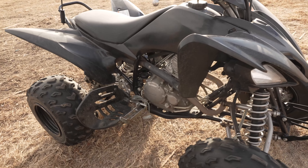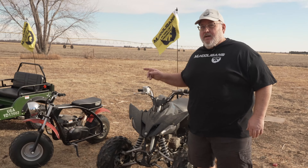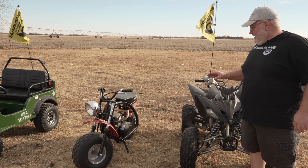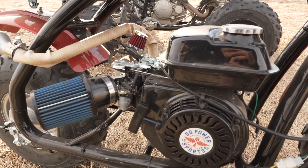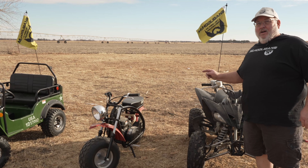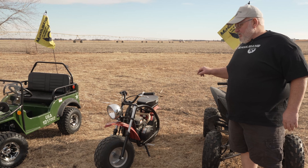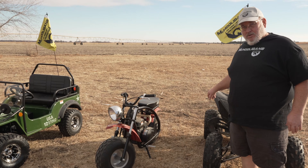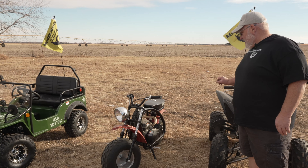We have a few vehicles in the fleet to compare lap times. This is a 2008 Raptor 250, bought new, and we've been playing with it. This vehicle over here is one I bought last year — it's a Coleman BT200X. We can't leave anything stock, so the 196cc Honda clone has had a stage one kit: new carburetor, tuned exhaust pipe, governor still on, K&N filter, aftermarket crankcase breather system, and the rear sprocket changed to a 60-tooth from the original 50 for more low-end grunt. Other than that, it's stock.